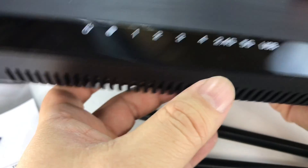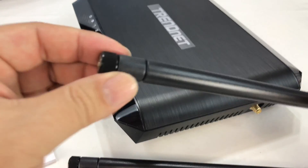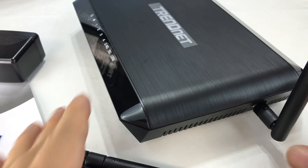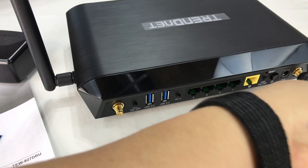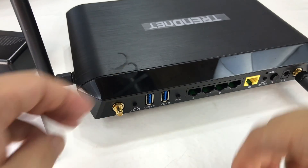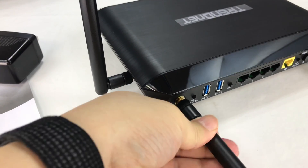There's an antenna button on the side and lights on the front so you can tell what frequency you're broadcasting on. What I'm going to do is get it physically set up, screw in all the antennae, connect it to the router, and plug my computer directly into it to get the configuration set up. I want it to have a friendly network name and a memorable password so that not only can I connect things easily, but my guests can also get online without major issues.